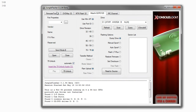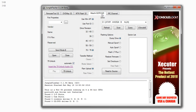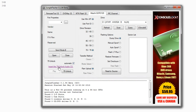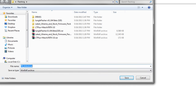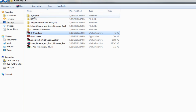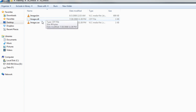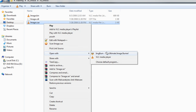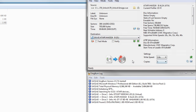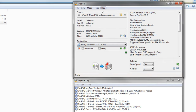What you want to do is come over to Jungle Flasher, go to Hitachi GDR 3120, and right here where it says '79 Unlock,' click the link where it says 'insert the 79 unlock audio CD.' You click that and it will bring you to a link where it will automatically want you to download 79unlock.rar. Save that, extract it — you're going to have a BIN, a CUE file, and a CDT. If you have ImgBurn already installed, open it up, open up the CUE sheet, and have your disc ready. You just need a regular CD-R and burn it over.